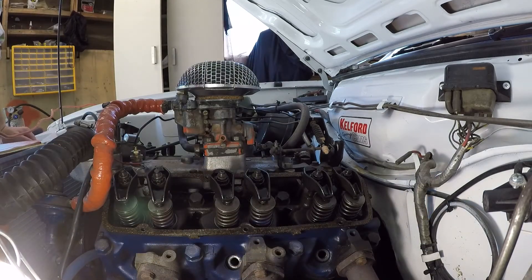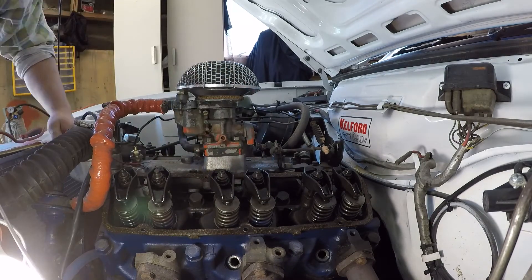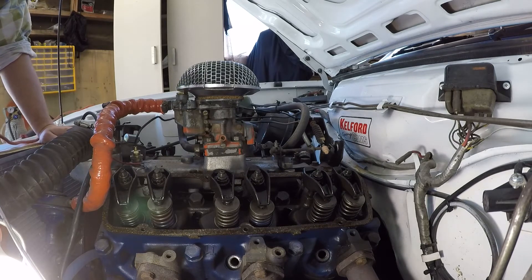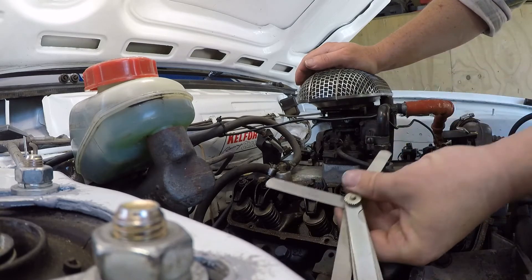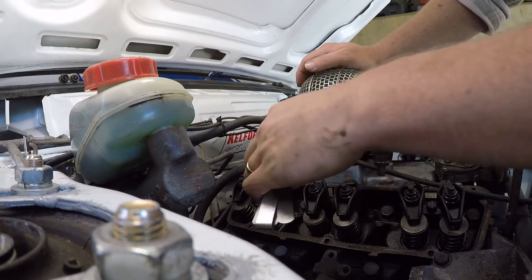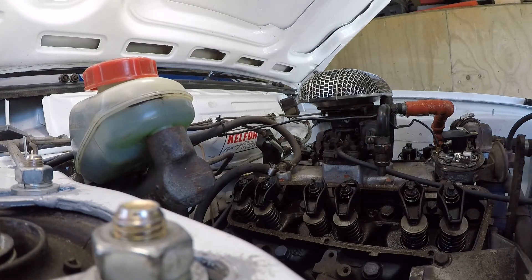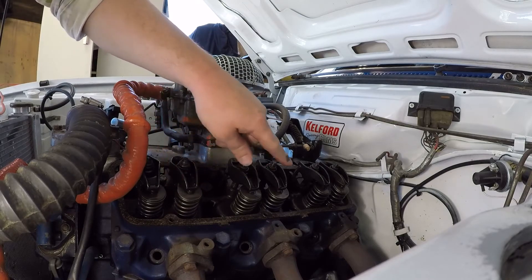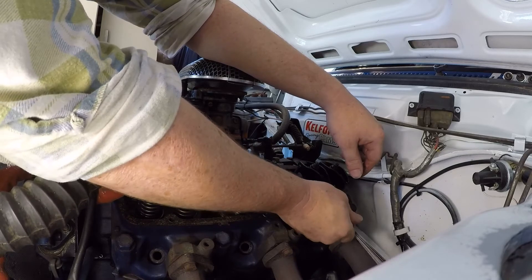That's done. We just had two and three open; now we need to go to seven and ten open, and we're going to check six and one. Number one is an exhaust — that's good. And now we're looking for number six which is an inlet — feels fine too. Next we open valves four and five, watch those open. Now we're going to check eleven and eight — seven, eight, nine, ten, eleven — check those. That's fine. Keep going, rotate the motor.